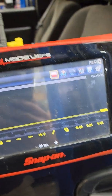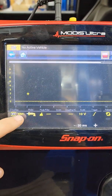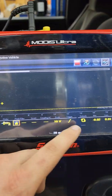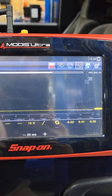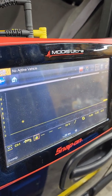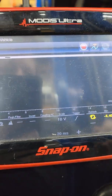If you use an oscilloscope, here's a little tip: I set it up for channel one. This button here — Peak — you set that to peak, and you set a trigger here at whatever volts you want. I already started recording; I'll cycle the key on so you can see something happen, then stop it.